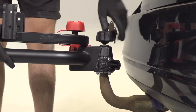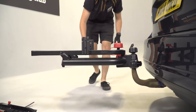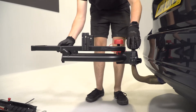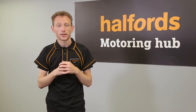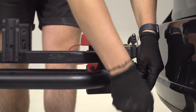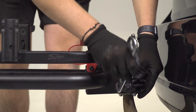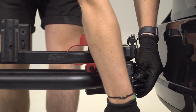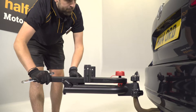Check that the quadrant pieces are fully over the tow ball and that the platform rack is level. If it's tipping up or down, then adjust it. Now that you're happy the rack is sitting correctly, do up the tow ball bolt. Tighten the hand wheel first — the quadrant pieces should pull up underneath the cone and grip the tow ball. Then, using the tools supplied, tighten the lower bolt. Using your arms, try and move the rack; if it shifts, tighten the bolt again.